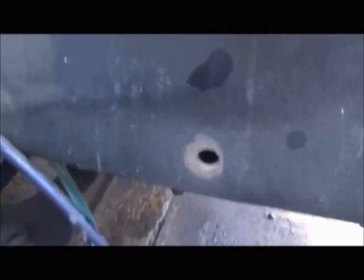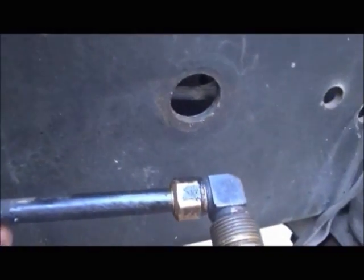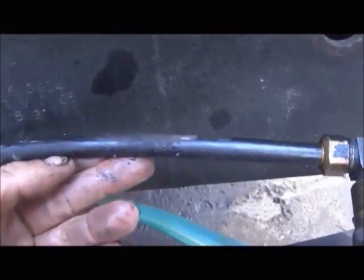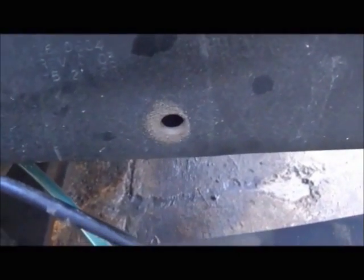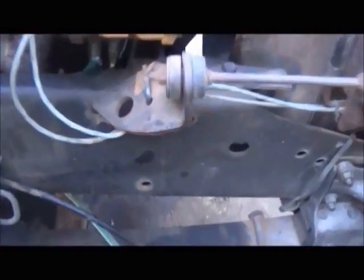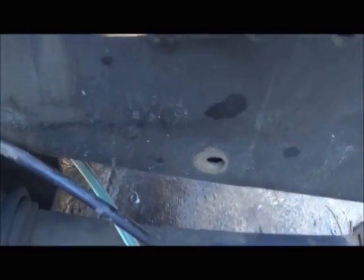Okay, what we have here is air coming in on our line before the pump, so we're not blaming it on the pump anymore. Plugged with the line a little bit — it's fuel line but it looks just like air hose. Tightened the back fitting, played around with it, and actually got it to where it wasn't as bad, but it's still leaking. So we're going to replace this entire line tomorrow. It's either got a little crack in it or the rear fitting isn't seating good on the compression fitting. We'll replace that and go from there. You can see how to do it — see the air in the lines. It's a pretty easy way to check, because air in the lines on a diesel will really mess with you.